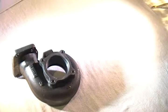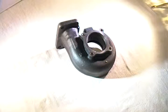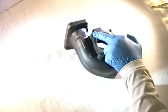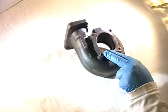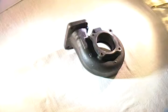Other companies have decided that if they can't cast one — because it's so expensive — they'll get one of these standard housings and weld their own flange system to it. They'll usually get them from an aftermarket company and weld directly to that, but again it's typically not a full three inch due to proprietary reasons. The issue is you have to make sure your welder uses the correct material, the right amount of heat, and proper penetration to penetrate the cast flange and center it correctly.